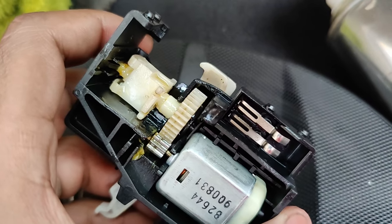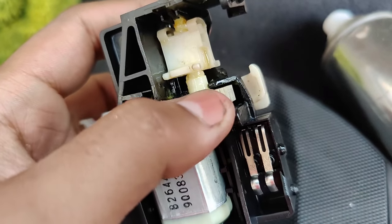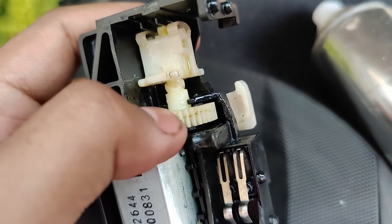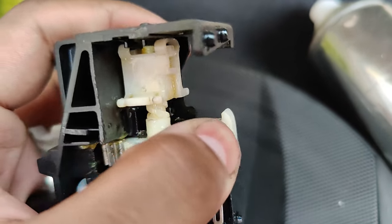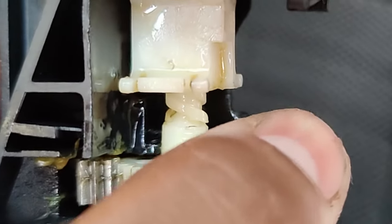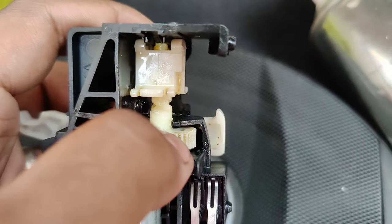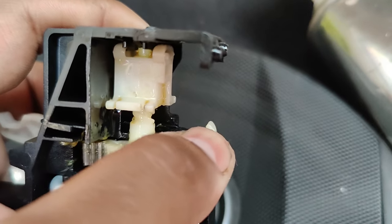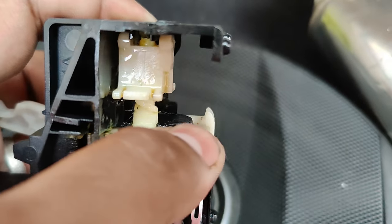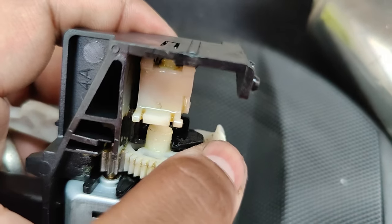So this lock will not work, because what I repaired was broken, but what I totally didn't pay attention to — one more thing is broken. You can see that shaft: it has a crack at the bottom, it's separated. That's why we're hearing clicks — the screw portion of the shaft is getting twisted. So there's no point repairing it now, because that shaft may not be able to get repaired.